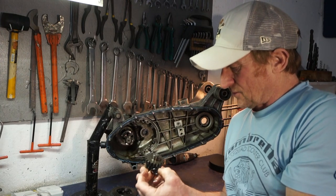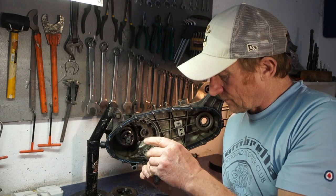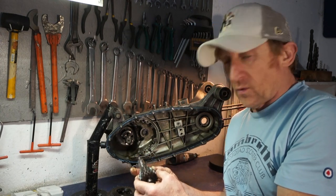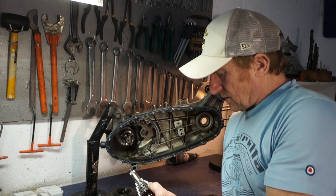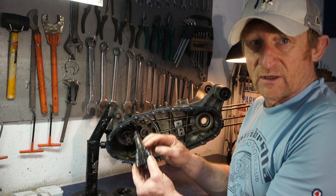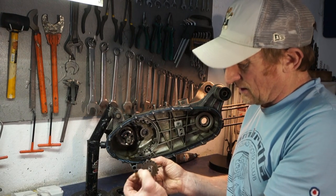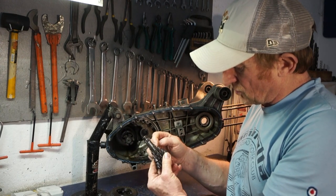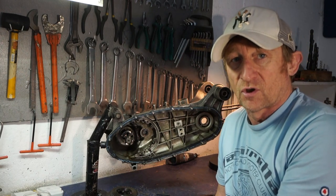Gearboxes, and it's been so far very good to me. I haven't had any problems whatsoever with it, although the fitting was a bit tricky. When I put the gearbox in, it tended to bite down on the first gear on the tree and lock up the gearbox, so I had to put a really skinny shim in the back and actually machine off the front top end of the teeth. Otherwise, every time I tightened down my end plate, the gearbox just locked up.